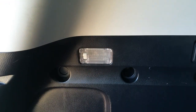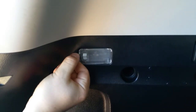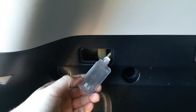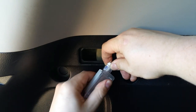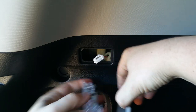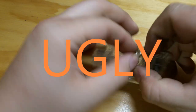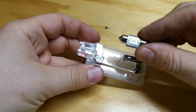To replace your trunk light — that's probably the easiest thing on this vehicle. You would also use the little flat screwdriver. Just make sure you turn it since it was on because the trunk door is open, and the whole thing comes out. Remove it from the harness by pressing on this little tab. You'll be able to remove the whole cover, then pull out the old bulb and replace it with a new LED. Just make sure you face it the right way.